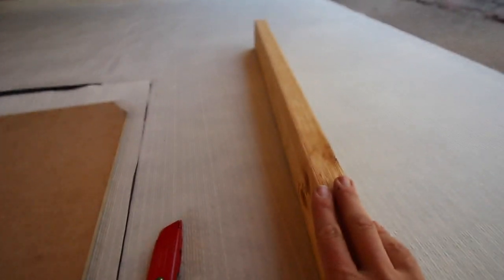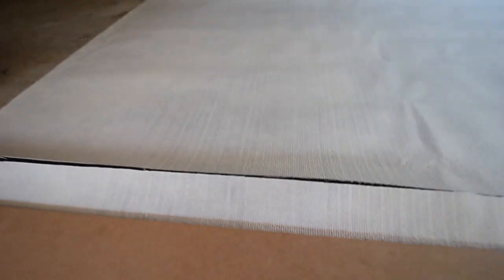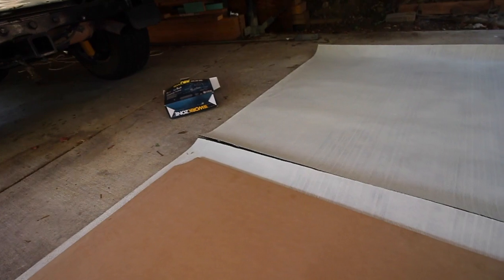To mark out the carpet, I'm using the timber as a template — I left a gap there so I've got a nice flat edge cut across the bottom. At the top I put it on the side so it's a bigger edge, so it actually folds further down when I go to staple it. That way I've got enough room to fold it over and staple it down without leaving myself short. Let's go ahead and get this all stapled down.